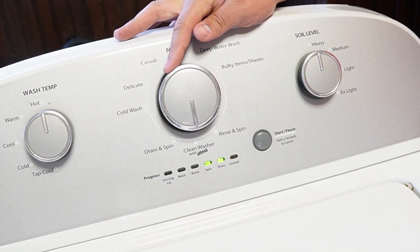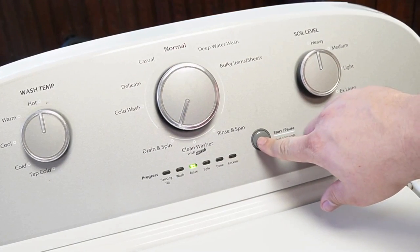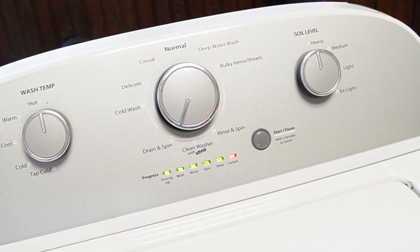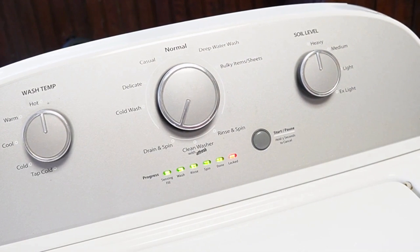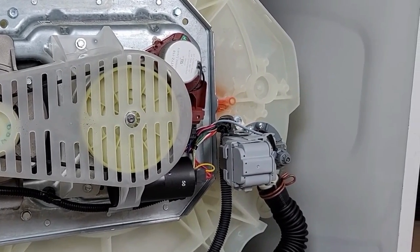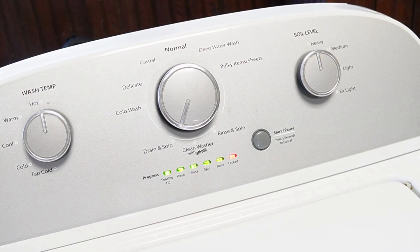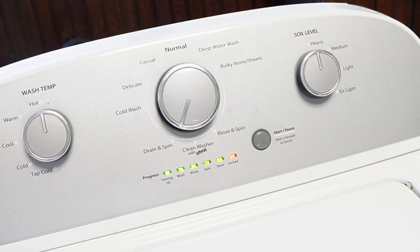Once you're in this mode, turn the knob clockwise four times. The rinse light should be the only one illuminated solidly — this is the recalibration mode. Once you press the start button on the rinse mode, the door lid will lock and it will begin a series of tests and operations on your washing machine. All these tests take approximately three minutes. As the recalibration mode runs, every part and process is going to be run and the machine will physically reset all the components to a default state, allowing them to run at an optimal level. This is a must-have when parts aren't working right or the machine doesn't know what state it's in, like after replacing the shift actuator or a control board. During this time you're going to hear all kinds of noises from the machine and that's totally normal.